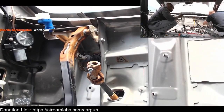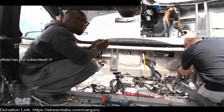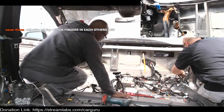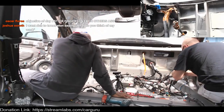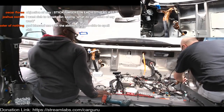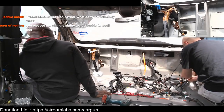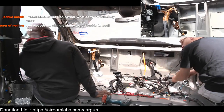That's wild. But the crimps, I'm looking at the crimps of the wires. Nothing's contaminated. Nothing's corroded. Like on these ground posts, there's a little bit of crud in between the nut and the stud here. We're going to take care of that, but I'm looking very closely at these crimps, and I don't see corrosion. That's a good thing. So corrosion is a good thing or a bad thing? Bad thing. Corrosion bad, not corrosion good. Yay.